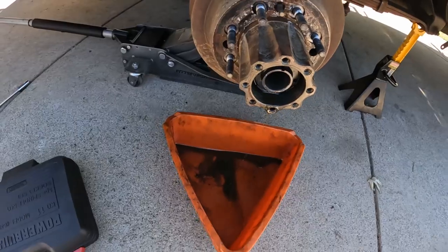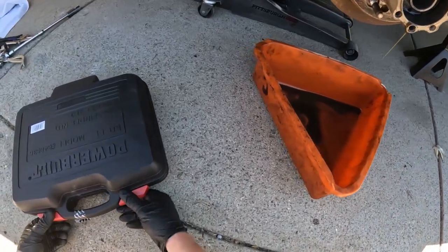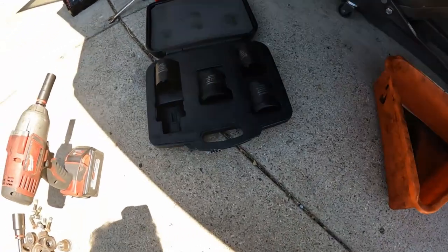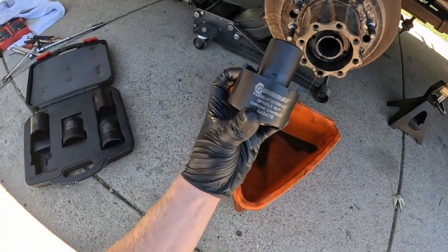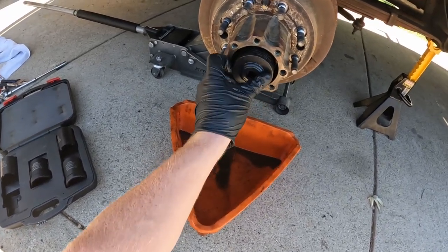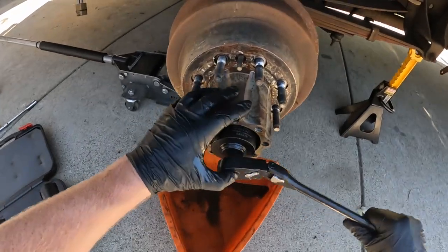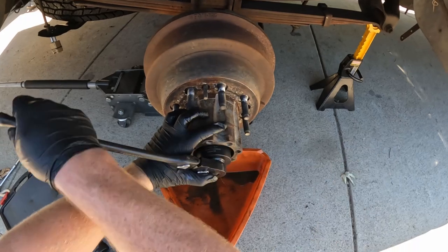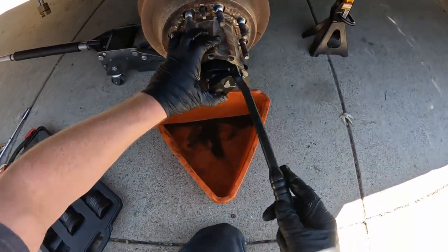The nut on the other side I had to go clockwise to loosen it. This other side is probably going to be just a normal nut. I've got this kit with a bunch of spindle nut sockets — this is the one I'm going to be using; there'll be a link below where you can get it. It just slides in there like that. Yeah, this side's normal — the other side is a reverse thread.